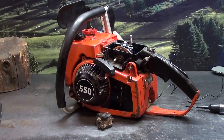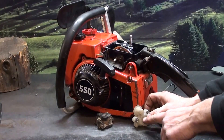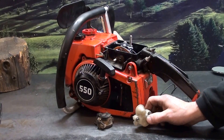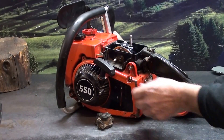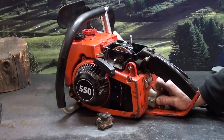Originally, Homelite came out with this little cover here — it was clear, semi-clear. It's got a little bulb in here and a diode. You take the spark plug out, put this on here, spin it over, and you see just a very faint glow. There's very low voltage there.